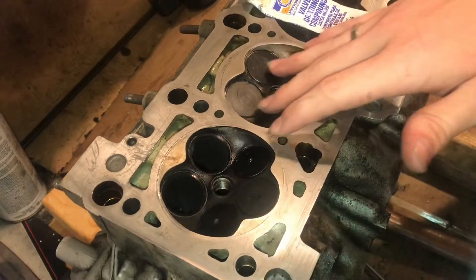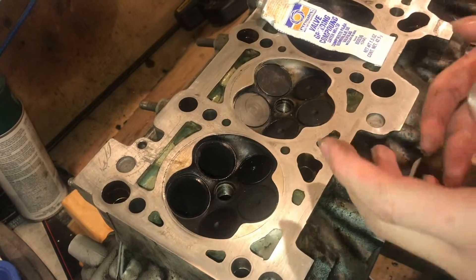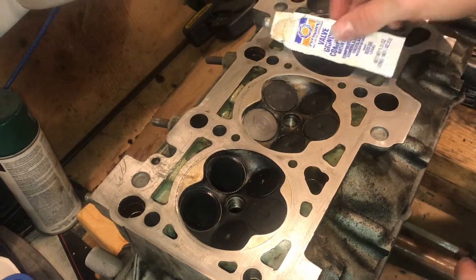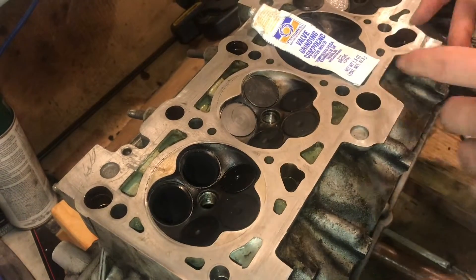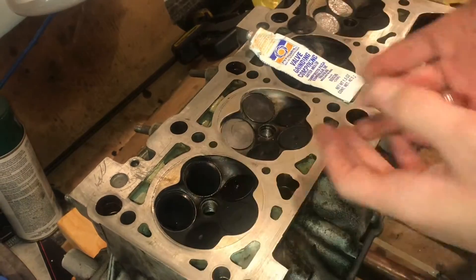Lapping is one of the most accurate ways to put that in. If you're making machining blocks that have to be accurate within millionths, you can use lapping compound and that will get it perfect. If you take two flat blocks and grind them together, this is a very precise way of getting two objects perfectly the same angle.